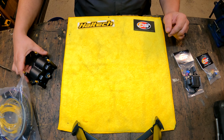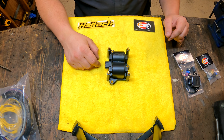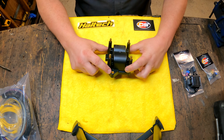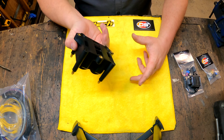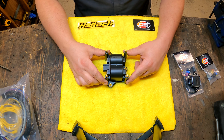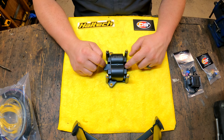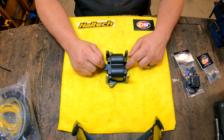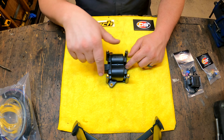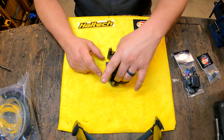All right, next big part. Wasted spark 4-pot coil. This will do a wasted spark for a 4-cylinder, special Dub Shop piece. It is super beefy. It looks like it's epoxy filled, so it's really ready for some vibration since the 914 sees a lot of off-road action from time to time. But basically, this is not going to run sequential. It's going to run what they call batch fire. So it's going to go boom, boom, boom, boom. And this is going to give me the ability to run no distributor, totally programmable ignition.